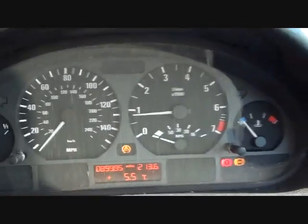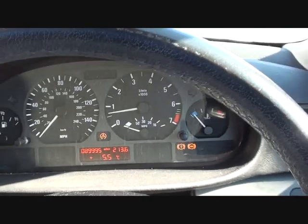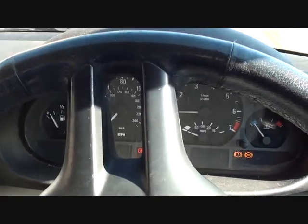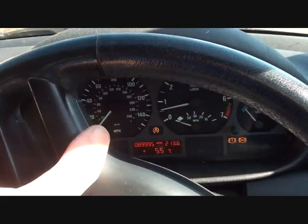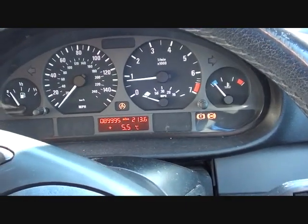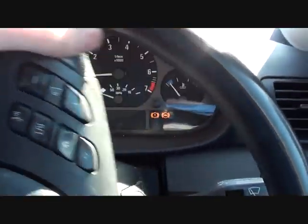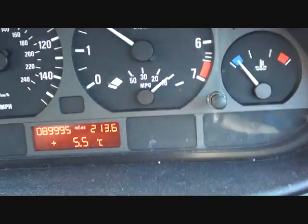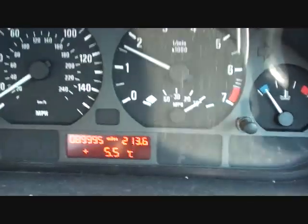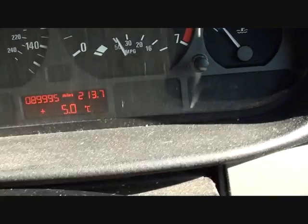As mentioned, the lights haven't gone out yet, but that's nothing to worry about. I'll just have to move the vehicle a little bit — I'm in quite an enclosed space, so bear with me while I maneuver and take it out on the road. Out of the enclosed space now, we can take it for a little drive and bring the speed up — and there we go, the lights have all gone out! The ABS sensor has been changed successfully. We don't need to hook it back up to the code reader, because we know the fault has been fixed — the lights have gone out on the dashboard, and that represents a success.